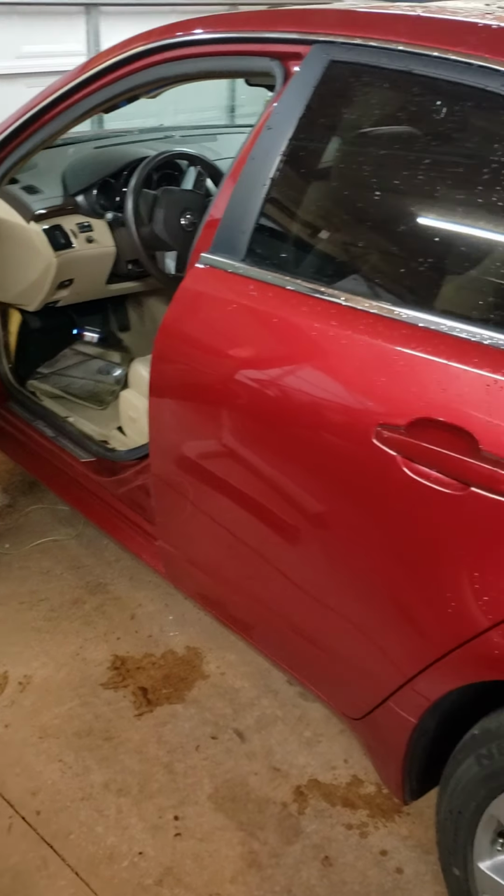So I just about gave up on the drain tube. Well, I had never really pulled the A-pillar cover off of the inside to see if maybe I had a hole or a crack or even see the edge of the windshield. So I dropped the A-pillar, and this is what you see. All it's got is a couple little push clips. It does have a little tab you just have to unhook. And then you pull the whole A-pillar out of the way. It's laid over there on the ground.